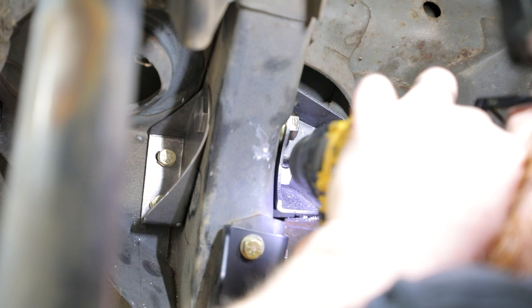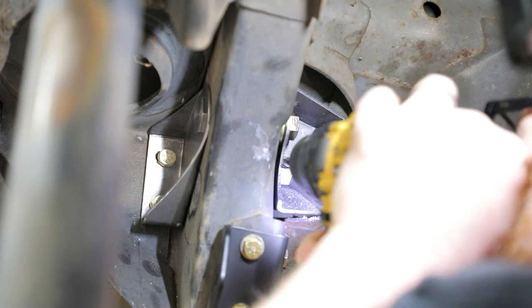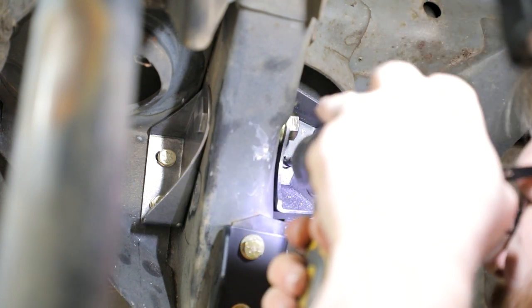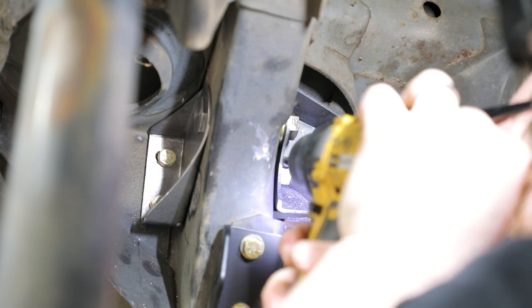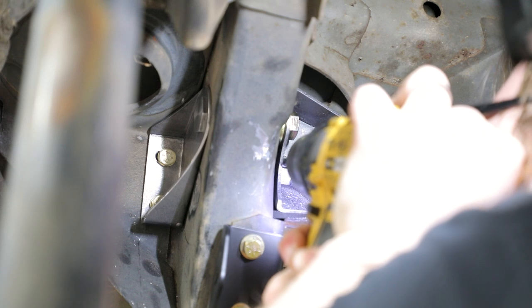It is recommended to keep all hardware in the swivel link brace assembly at least until you have an established center point spot drilled on the floor pan behind the swivel link brace assemblies. If you have to remove the hardware, just remove the frame rail bolt. You don't want the brace assemblies to shift, as they are acting as a drill guide to find a good location on the floor pan.